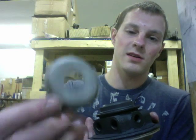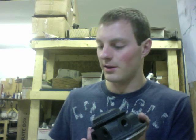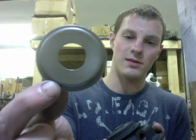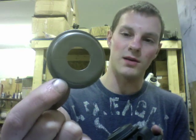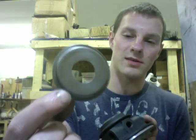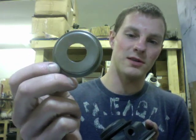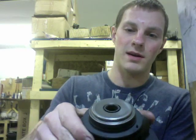In this case, your heat shield is going to look like the factory piece. But in my case, since we did an upgraded shaft, the factory heat shield doesn't fit anymore. So what we have to do is install a TD-04 Subaru heat shield. You have to make sure you get the right one if you're doing this upgrade — the TD-04 series has like three or four different heat shields. So take the heat shield and put it on the back of the bearing housing just like that.